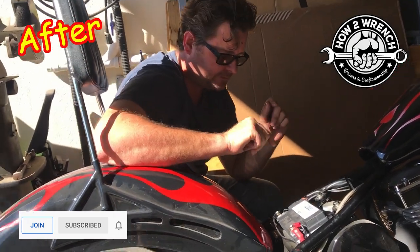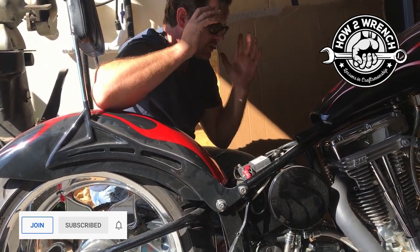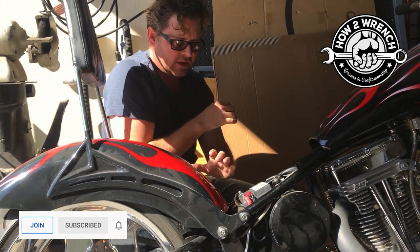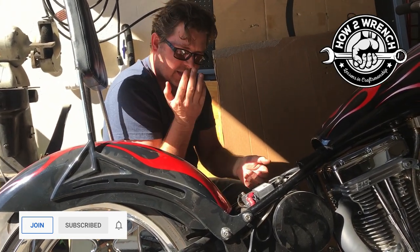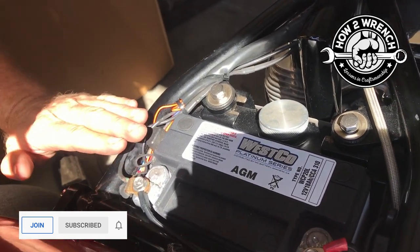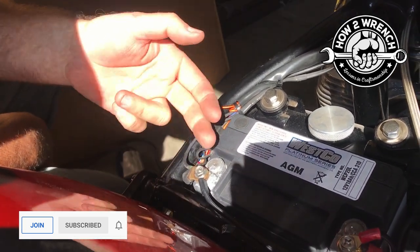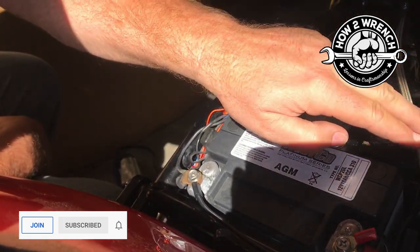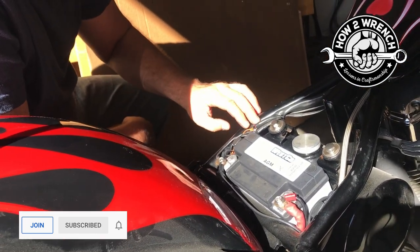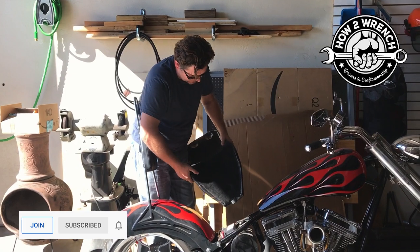Make sure my key's off. When you see a problem like this, especially in the chopper world, one of the first things you need to do is grab the seat and see how it mounts — see if it's pinching wires. Come a little closer: you can see this wire is laying across this piece of frame tubing right here. Maybe what was happening is every time the seat came on here it was pushing on that wire, causing fatigue to break it over time. Maybe the seat needs to be relieved. We'll grab the seat and see if it hooks under here and sits back here.